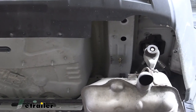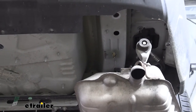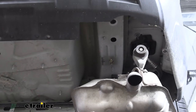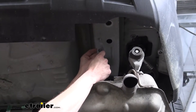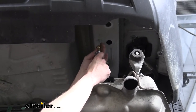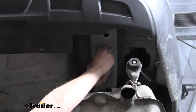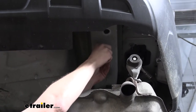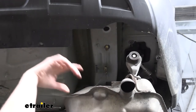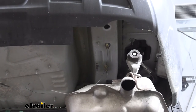We're now gonna do a similar procedure to that. It's a reverse fish wire for the larger hole that's behind it there. So we're gonna take our coiled wire here, go ahead and place your spacer over the end of the coiled wire, and then take your bolt and thread it onto the coiled wire. Push the bolt up into the frame, push your spacer up in there, and then you can pull the bolt back down like this. We're also gonna prepare the opposite side the same way.